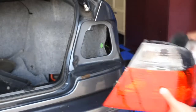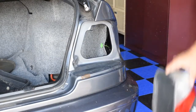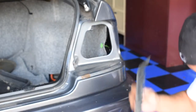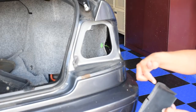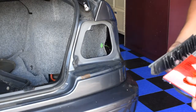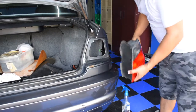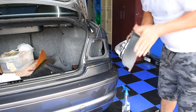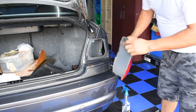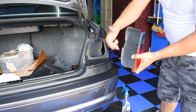Now we can take our new light - this is the old one. We're going to have to remove this piece and put it on the new one. Pop this off. This one's torn up - I'm going to have to buy a new one. I don't know where to get them, probably FCP Euro or something. Once you get this piece off, you lay it on here and push it in - it'll clip. There are clips it clips into. I'm going to need new ones because the rubber is missing, but I'll put them on for now and definitely replace these later.